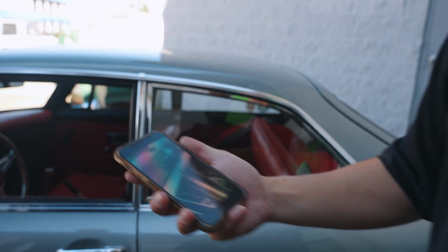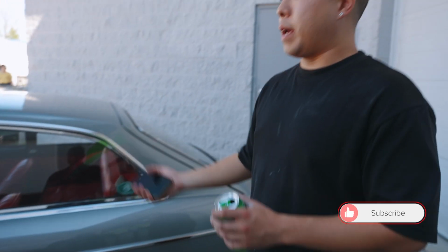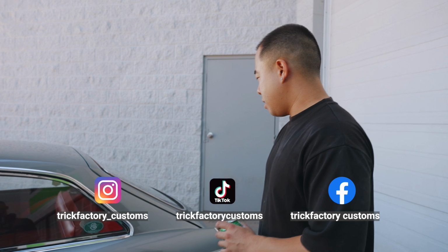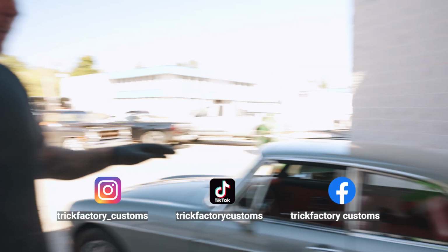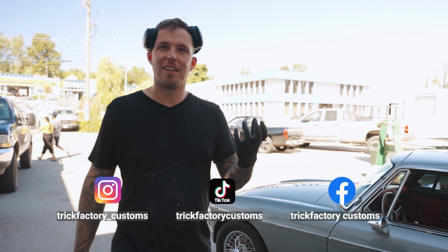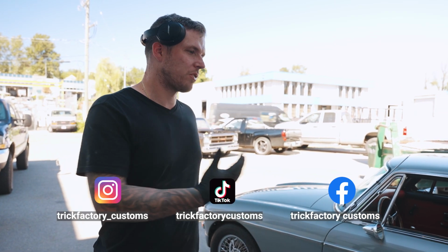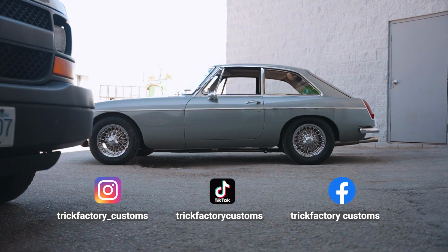You have to bring it down to bare metal, because if you're doing a complete paint job, you don't want to risk having something bubble up later. After everything you've put into it, it's hard enough to do without old stuff underneath. We have to start from scratch and do it from the ground up. So we just follow our steps and procedures that we normally do.